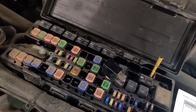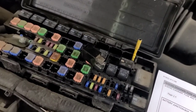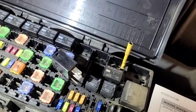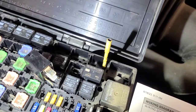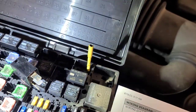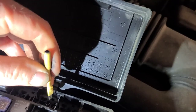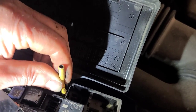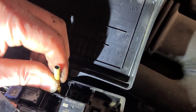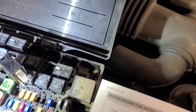Why didn't it start? Oh, the key is on, yeah. I don't have the fuel pump relay in there right now. Anyway, look at this rad support here — it's magnesium so I've got no place to stick a magnetic trouble light. The pin grip on this relay terminal is not as good — that one's a little loose. I'm going to reshape that terminal and swap out that relay.